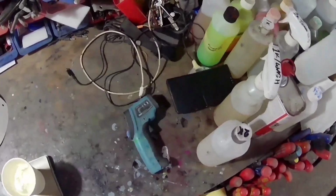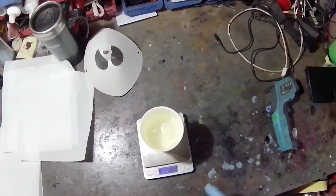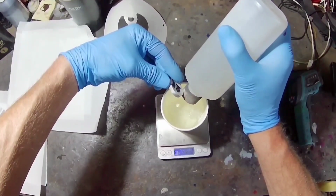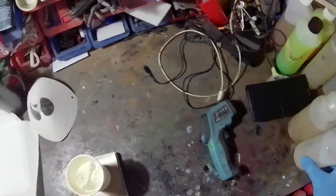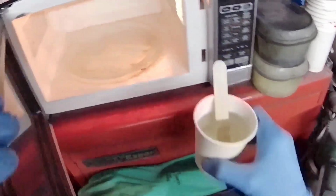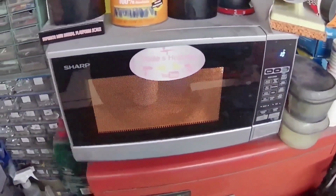You can put two coats on if you want to, but one good coat of clear should normally be fine, because you've already got the UV build up in the underlayer clear that you've already put on there. So you're getting a normal MS or most HS, a sort of two good coats of clear, or a tack coat and a good coat of clear. So you're going to have enough on there with just one coat of clear over your artwork. That would be perfectly fine. So that's the best thing to do, I find.